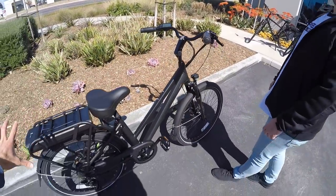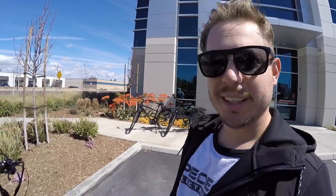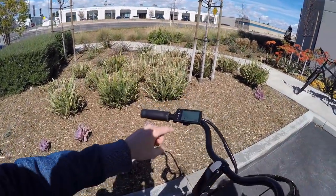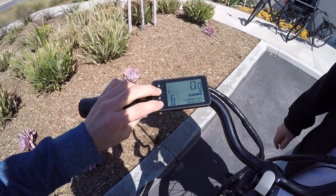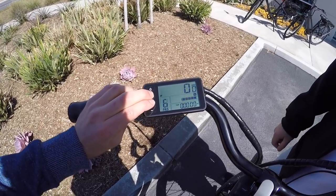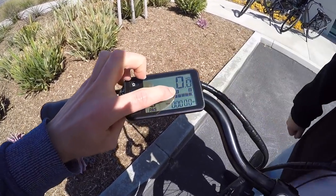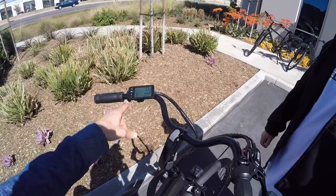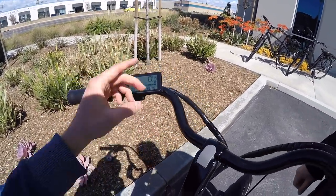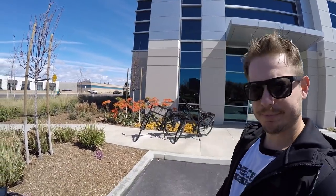The display panel also has a full-size USB Type-A 5-volt 500-milliamp charging port — great if you're running the app, GPS, speakers, or even decorative lights. To activate it once out of the menus, hold set and press plus, and the USB icon appears. The reason it has a dedicated toggle rather than being always-on is similar to the battery's deep-sleep mode — it prevents accidentally leaving something plugged in and continuously draining the battery.